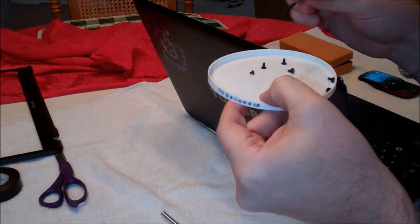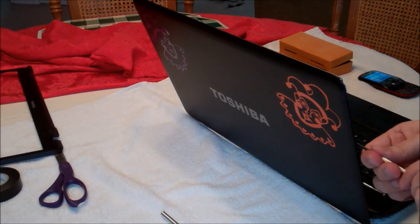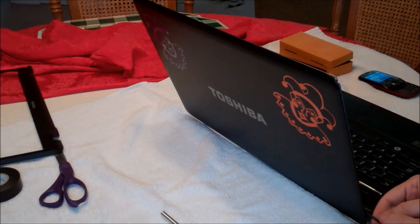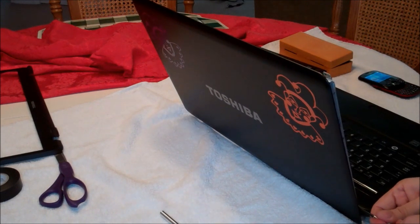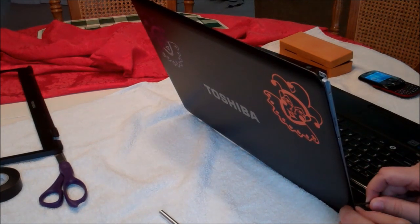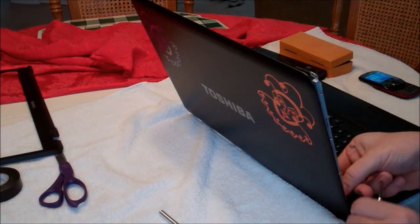You can see how the hinge screws are a little bit longer than the ones that are actually going to hold the screen in. You want to get the correct part number because it's not just the size — the width and height of the screen. You also have to think about the depth the screen will need, plus the pin set and where the pin set is located.